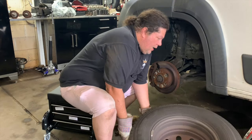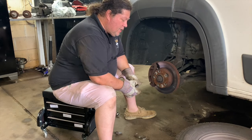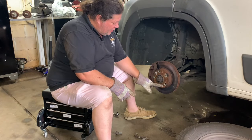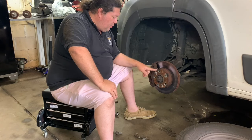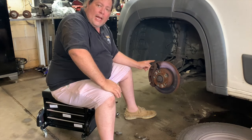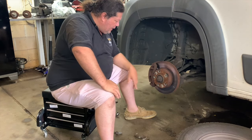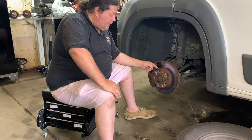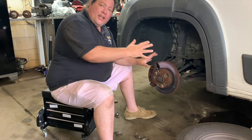Generally speaking, good practice is to put your tire under the van such a way that if the van falls on it, it'll at least capture the rubber of the tire. Another smart thing to do is roll it out such a way that it'll roll back and be lined up because of these two locating pins. I'm going to leave these on because unless I find something with a pad, I'm not going to do anything with this. Doing it on this van, which is one of mine, is just more of a demonstration. But I want to show you how to get the caliper and the bracket off if you need to. These are 10s or 12s, something like that, and they just come out. If they fight you, don't worry about them breaking — you don't need these if you lose them. The lug nuts hold the rotor on; these are just there to guide the tire as it goes back on.